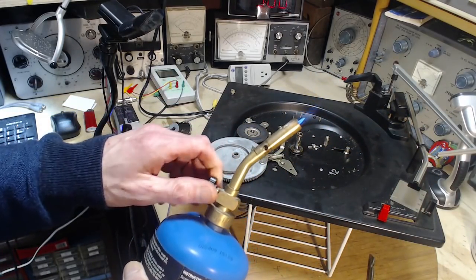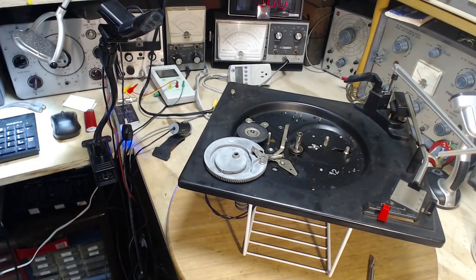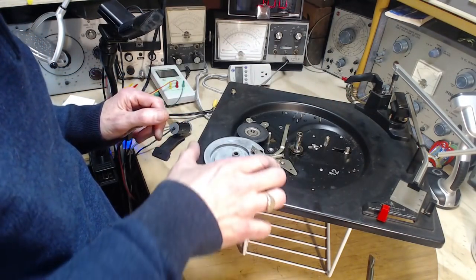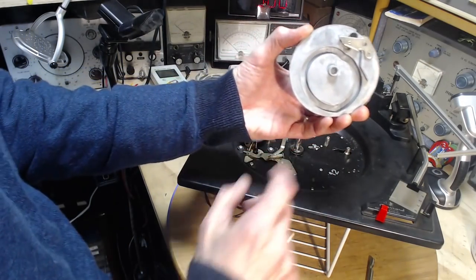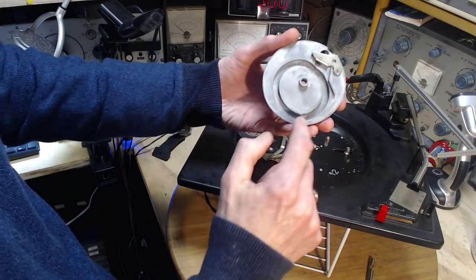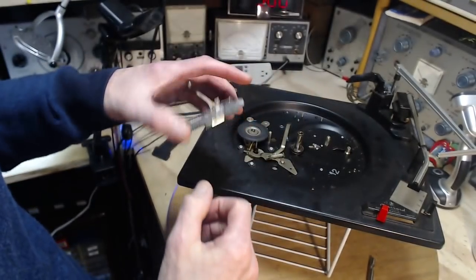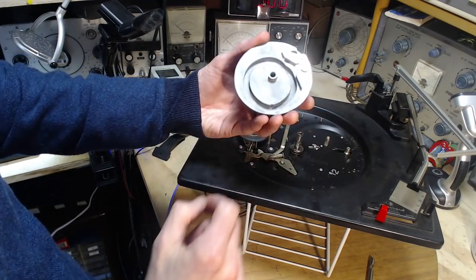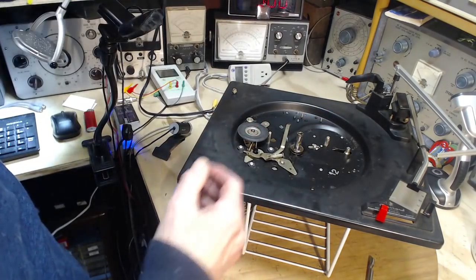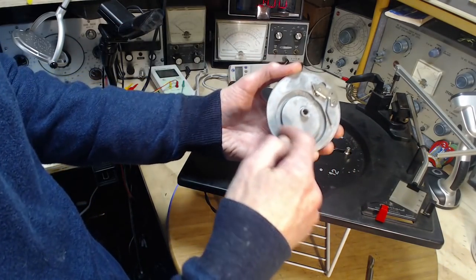This really saved me. The alternatives to getting this off would be a lot of mechanical working, and because this post appears to be turning, none of that's too good. Look at the degree of lubrication in here — it's pretty much zero. It's as if there'd never been any in there. So this should have grease in it. This is the raceway — that funny shape drives the tone arm back and forth automatically. It's all about following this funny shape.